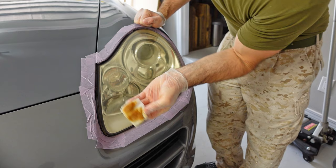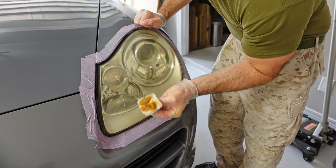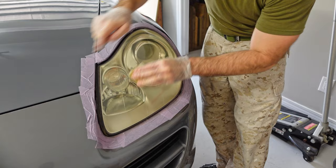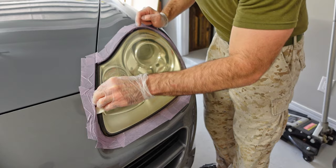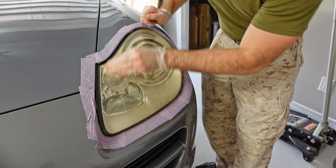And that's what we're talking about as far as it turns yellow — although this is more like a goldish brown. Now during this process, you may want to have your hood open if it gives you better access to your headlight, depending on how your headlight is shaped. I don't really need that because I've only got a little strip and I can just easily reach in with the pad and get to that edge, which is also why I went ahead and taped everything off so I don't have to worry about it getting on the paint while getting into this edge.